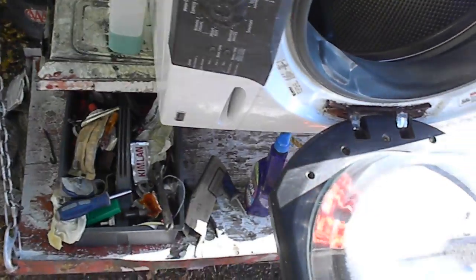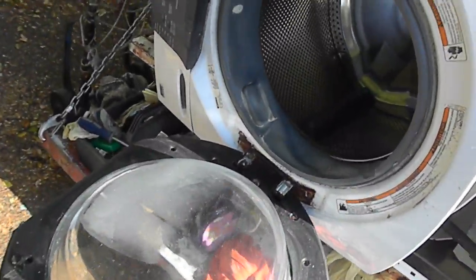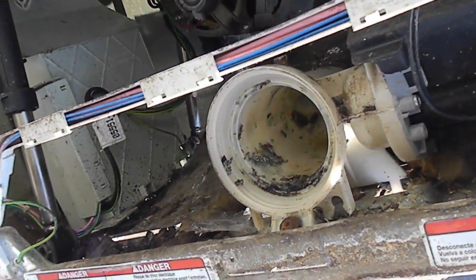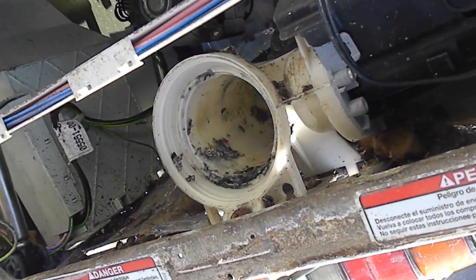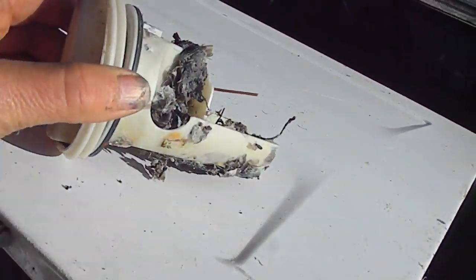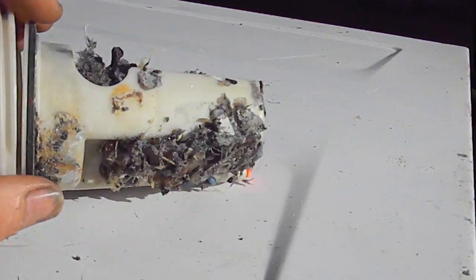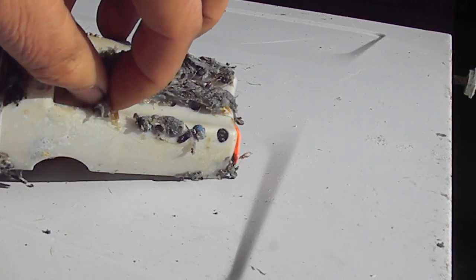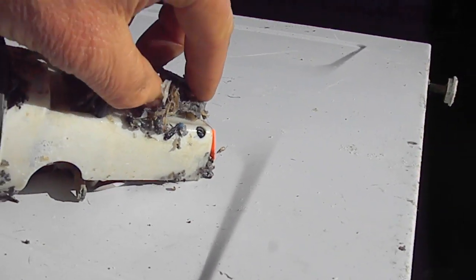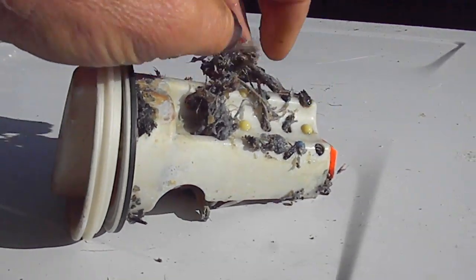Write your sheets out for work if you ever do any work. Basically, the complaint was that it wasn't spinning out. Here's your pump right there. I've already pulled the filter out. This is the filter — it screws regular thread, counter-clockwise to pull it out. You can see that on the bottom of this filter, all the little ports are plugged up — all the little areas for the water to go through and out are plugged up.